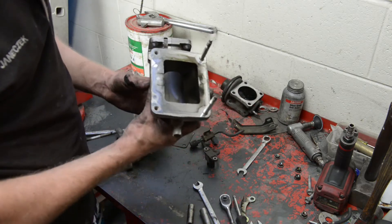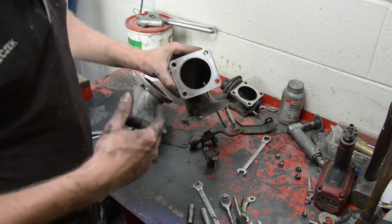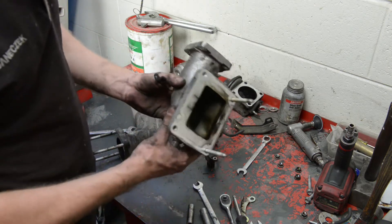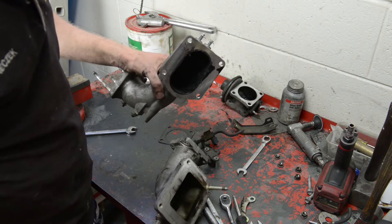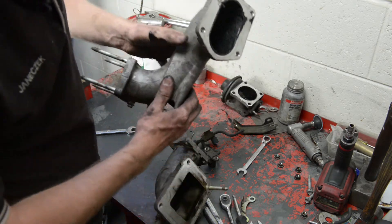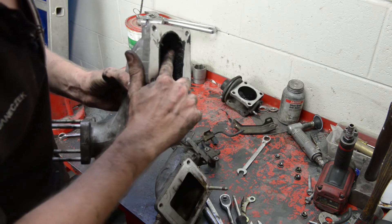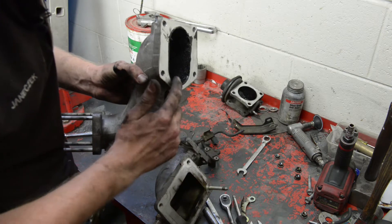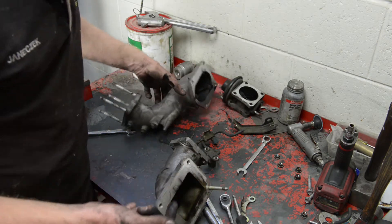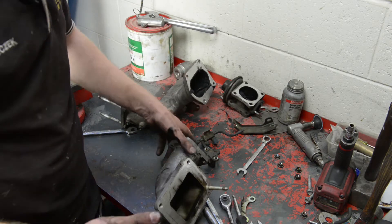This end is a lot cleaner because it's just taking in air — air slash oil — before the EGR. This other place is just messed up because of the EGR. You can see that section there — look at that — that's all the way through your intake.